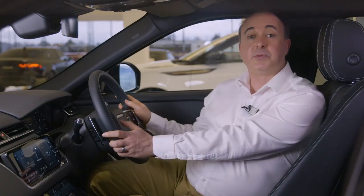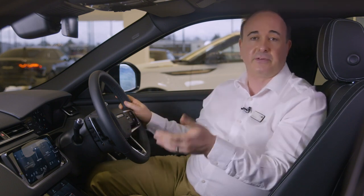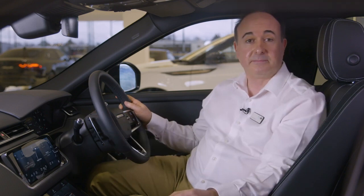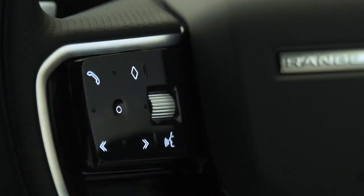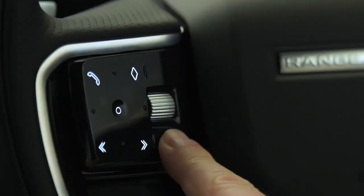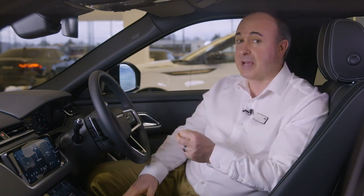On the left-hand side, the button marked with a small circle accesses the menu options for the instrument panel, including trip records and display layout, and head-up display if fitted. The arrows allow you to navigate through these menus — left and right to choose categories, up and down to select options within those categories. Select options by pressing the centre button. The phone icon will answer an incoming call, end a current call, or start the process to dial a contact on a connected phone. The voice button primes the system to listen for voice commands — just wait for the chime and then say something like 'tune radio to BBC Radio 2'. Alternatively, you can use a wake-up phrase. Enable this via PIVI settings — you may also want to disable confirmations. Initially set to 'Hey Land Rover', you can also set a name of your choice, for example 'Hey Sophie'. Names with at least two to three syllables work best. The system uses natural language understanding, so commands could be 'Hey Land Rover, call David's mobile', 'Hey Land Rover, take me to Buckingham Palace', or 'Hey Land Rover, increase cabin temperature to 22 degrees'.